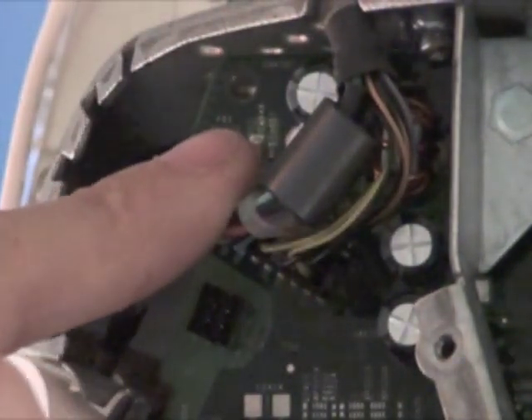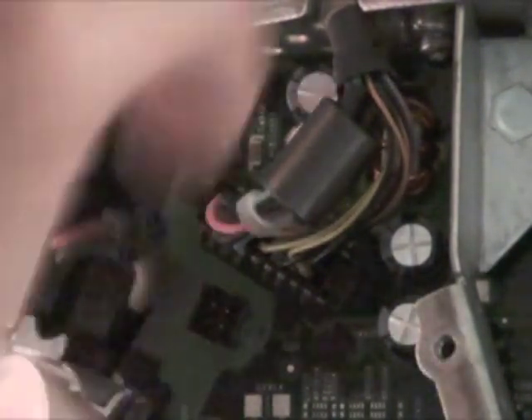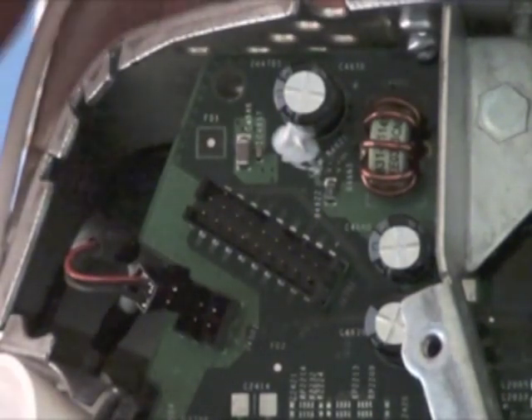This one you might actually have to wiggle out a little bit. This one is potentially dangerous because it's your video cable, and you can really screw it up — you have three capacitors on the side of it and really small wires that can easily break. What I recommend is getting your screwdriver and prying the clip off the base of it. Now that it's loose, it should just come off real easily. So however you want to get this cable off, don't break anything. It's your only video cable, and if you break it you'll regret it and have to send it in.